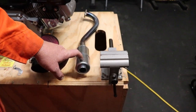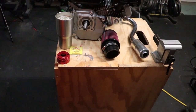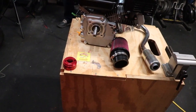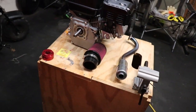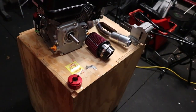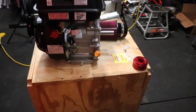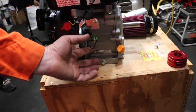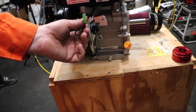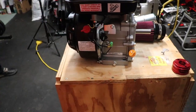You can select the exhaust with the muffler, you can select the trumpet exhaust. There's about 15 different options depending on the kit that you purchase. As we started looking at this thing, you can see that we did get the gas tank back on. You saw in the governor removal that we snipped this wire and we prepped this to receive the butt connector from the Monster Moto frame. We'll put the Monster Moto frame ground lug right there.